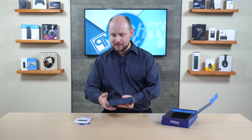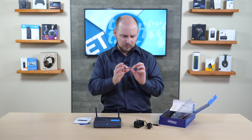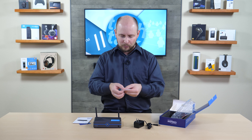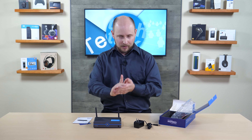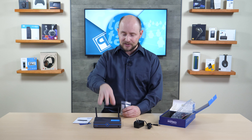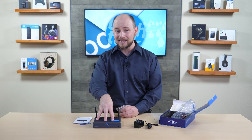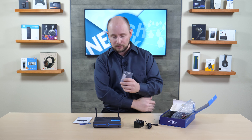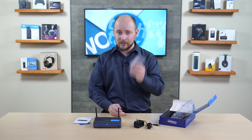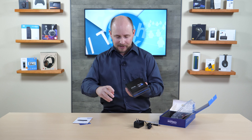In the accessories box, you get a power cable, some replacement screws, and a thermal pad. The thermal pad is double-sided and is intended for the NVMe drive — you'll want to use it because NVMe runs very hot. SATA SSDs typically run cool, and spinning 2.5-inch drives get moderately warm, but NVMe absolutely needs proper thermal management, especially in a fanless system.